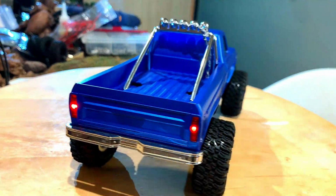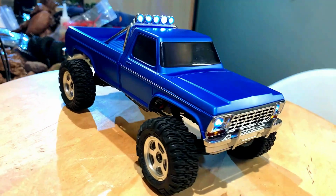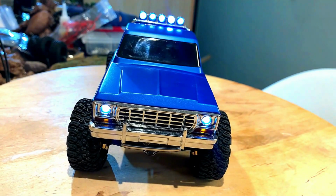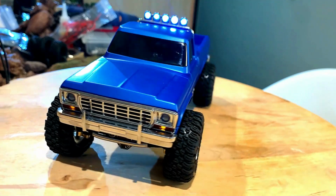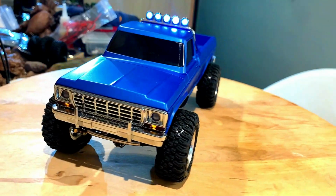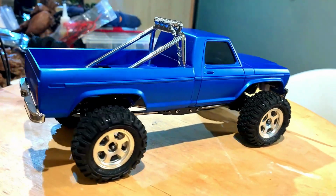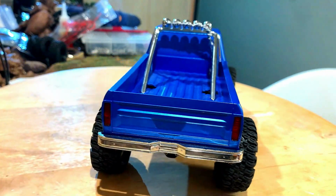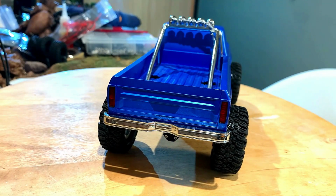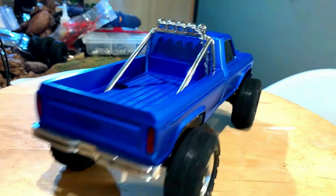In this build, we've focused on performance, especially improving the vehicle's crawling ability with a long wheelbase of 140 millimeters, just slightly more than the 139 millimeters of the FMS Smasher body. Coupling that with a low center of gravity gives this RC truck incredible stability over rugged terrain, making it perfect for crawling. We're proud to present our custom 1/24th scale RC crawler built from scratch.